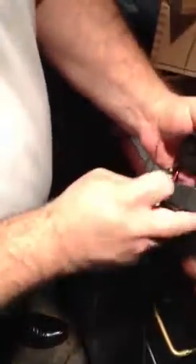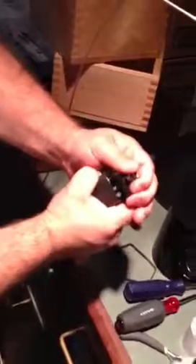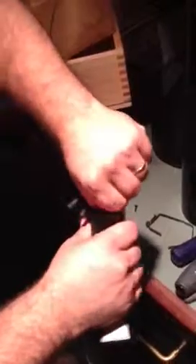The transformer has screws on top with a little zip tie around it — break the zip tie. There's double-sided sticky tape holding it together, so peel it off. There's also a small spring inside, so be careful not to lose it.